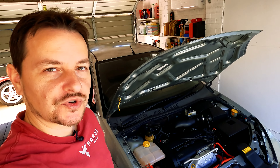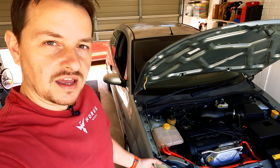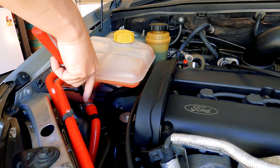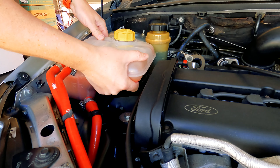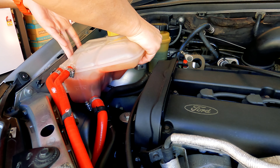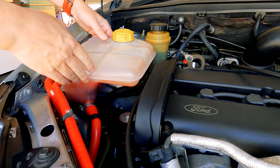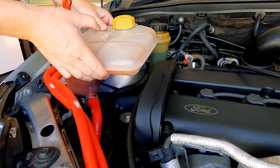The way I'm going to try to do this is minimize the amount of coolant I have to take out of the car. To do that, the first thing we've got to do is get this bottle loose. There's a 10mm bolt just there which you need to undo. Once you've got that 10mm bolt out, this coolant expansion tank will literally just come off. Undo any clips that might be holding it in.